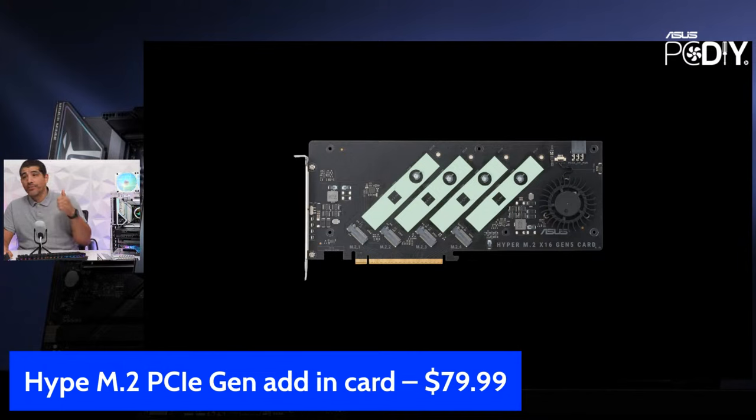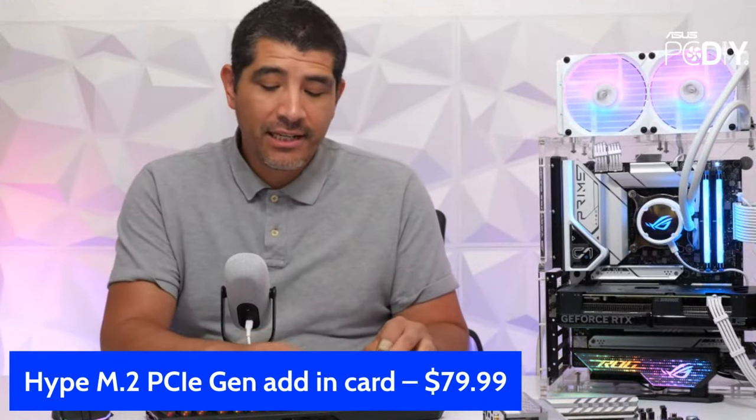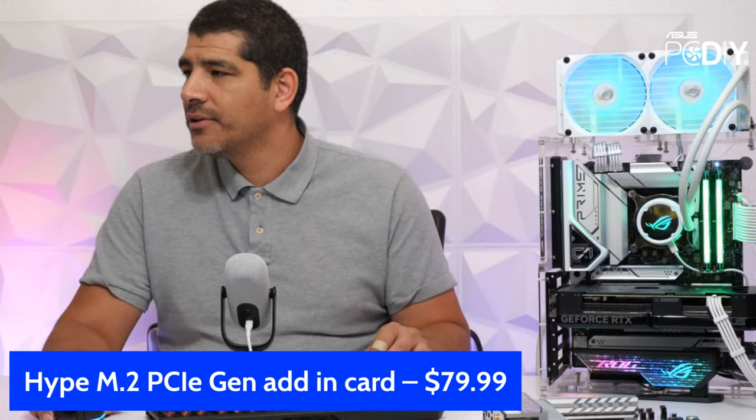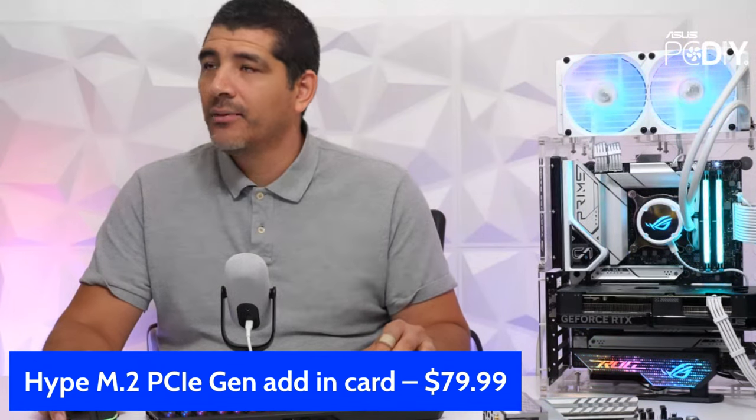So one, your motherboard needs to support PCIe bifurcation, and then ideally, if you want PCIe Gen 5 operation, it also needs to have a secondary slot. Now, many motherboards will not necessarily have a secondary PCIe NVMe slot. So let me go ahead and show you an example of a motherboard that would support a secondary slot that would be high-speed